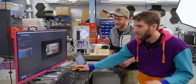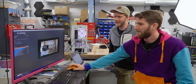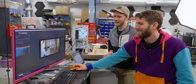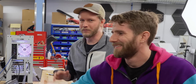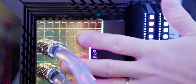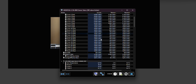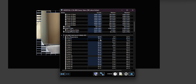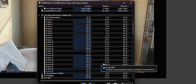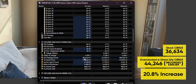What does that look like in terms of Cinebench then? Very fast, extremely fast. It also is worth noting that that was with the voltages pretty high. You don't get any more performance after about 480 watts. This block is dangerously close to condensation territory here. Oh yeah, that's a rock solid 6 gigahertz on all performance cores. That is wild. The temps are getting high, some of them are getting into the 90s, but still reasonable. 480 watts.